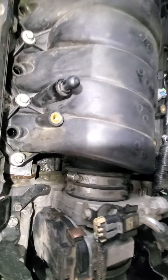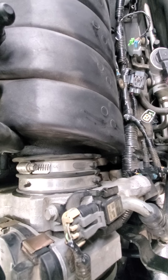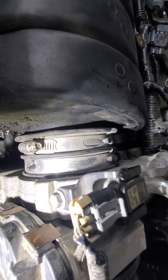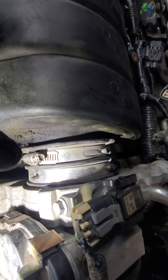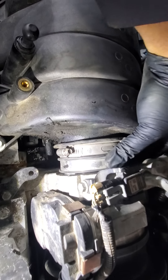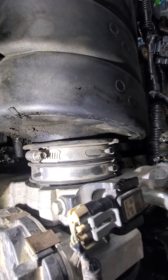When you put this boot on it should be flush against this surface. The boot is fairly flexible and you do have to tighten both clamps — the other screw is in the back. Before you put in your intake manifold bolts, really make sure that the edge of the boot isn't caught on either side. Run your fingers down underneath and over the top to make sure the boot isn't caught inside, because you'll have a major vacuum leak — it'll idle like crap and your fuel economy will be absolutely atrocious.